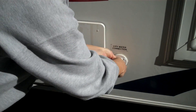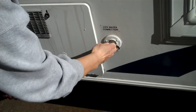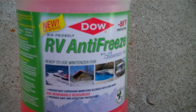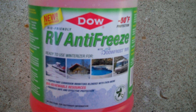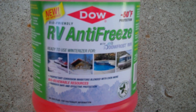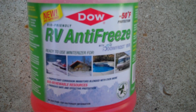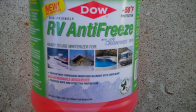We'll close that up and take this out. That pretty much takes care of the water outside. Now I'll show how we put the antifreeze in the sinks inside. This is what we put down the sinks, into the traps, and into the toilet - it's specifically RV antifreeze. Some people actually run this through their lines by running the water pump so it sucks it through. If some of this happened to be left in the water it's not going to kill you like regular antifreeze would.